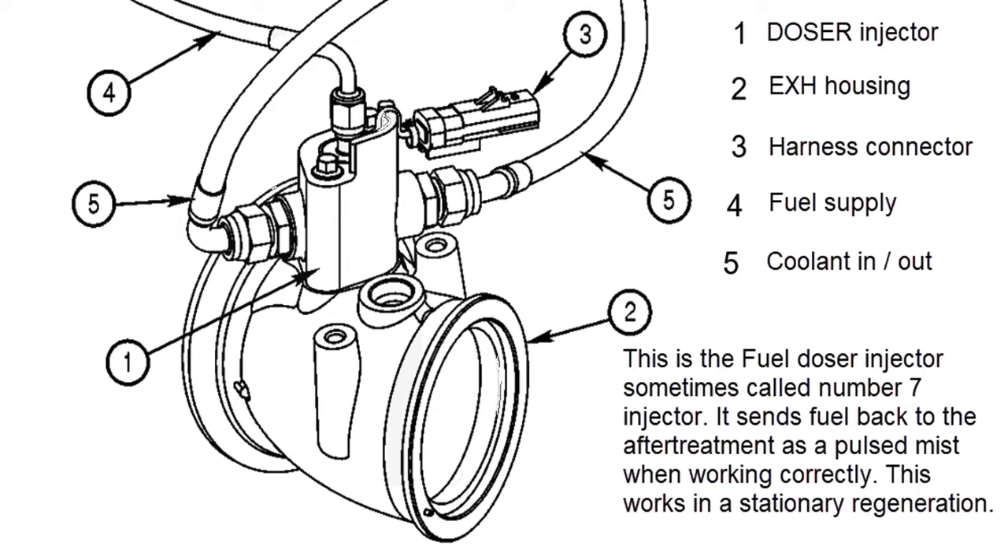If it can't get above 1,000 degrees and the ECM has pulsed longer on and shorter off — remember it's pulsed, and when it's on that poppet is open — 275 pounds of fuel pressure is coming in, and that's what causes it to mist. There's no pump; it's pure pressure driving it. When the ECM shuts that off, a needle drops into a seat and no more fuel is allowed out. The ECM watches the temperatures in the after-treatment and learns how much fuel to send in how much time to get that temperature up for a successful regen without overheating and cooking the after-treatment.